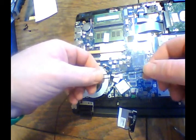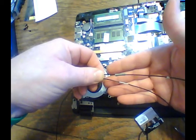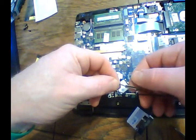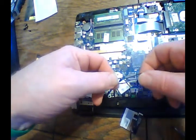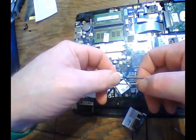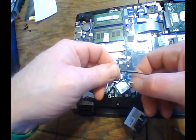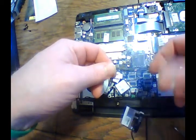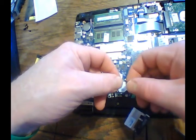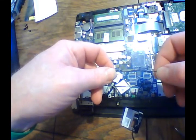hopefully you can see this here against my hand. See on that lower wire how it looks like the insulation is actually stripped back? It is. Where the tape was for those two to be connected, I don't know why that would be pulled apart. So we're going to try this with just using the one wire of the new kit and using the existing wire as the number one, and using the new one as number two. Now I've gone ahead and taken that tape and wrapped it back around this so that it at least covers that exposed part of the wire on antenna number one.